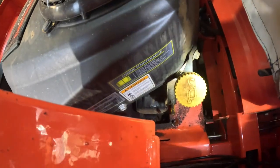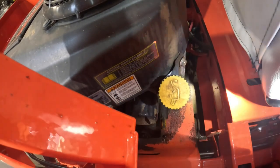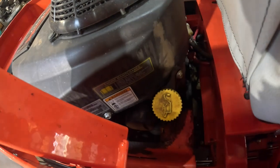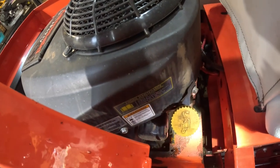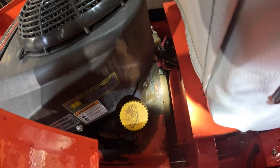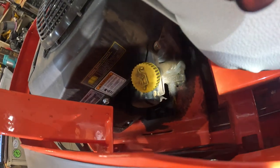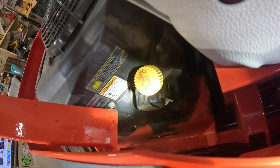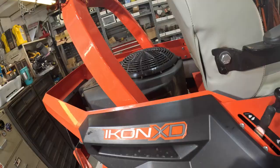They are not making this easy — there's the oil drain way down at the bottom, right on top of the frame, and then the oil filter is right there. It's going to drain right on top of that transmission and make one hell of a mess. You can see it's already been leaking a little bit — all that nasty dirt stuck to that oil. The oil filter has a little channel under it that'll direct the oil right on top of that transmission.